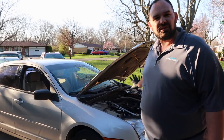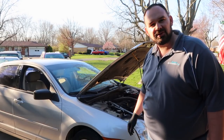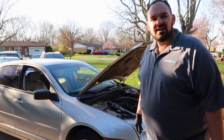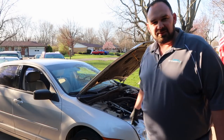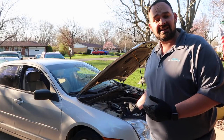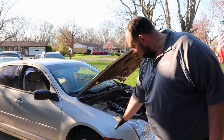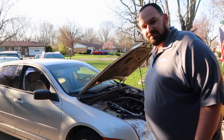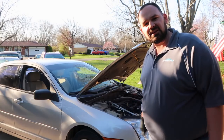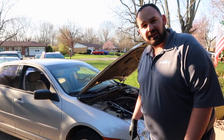All right, got everything under the hood assembled. Got that fabric piece that goes on the bottom of the hood put in — it's just 10 clips that hold it in place, so that was pretty easy. And I got some bumpers put in that I had forgotten to put in before. So now I'm going to go ahead and take the bumper cover off so that I can replace this plastic bracket and also adjust the plastic crash piece that goes in between the bumper cover and the crash bar.